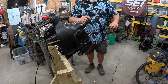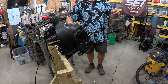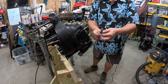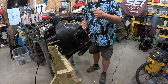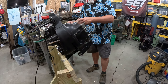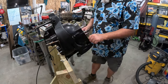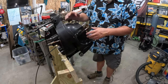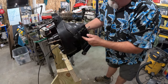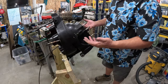The cable itself seems to be in all right shape. One thing we don't want to lose is this little guy on the end here — this will go under our new cable. I'll just coil this up and hang on to it for when things start going back together. Now that it's free, the only thing holding us together now is the rubber boots. Normally you can take the rubber boots and just unscrew them where you can get to them, but since I'm replacing them, I'm going to go after them with a knife.